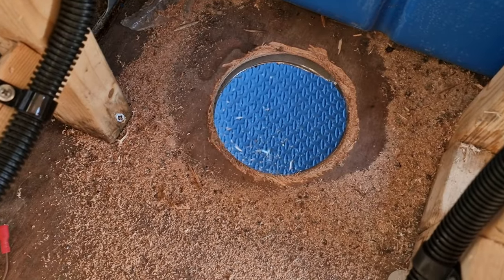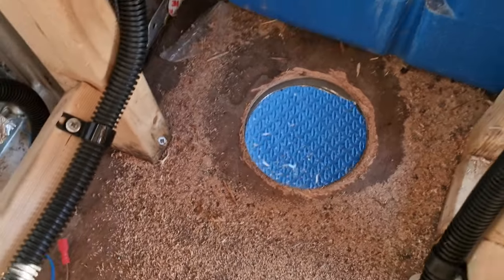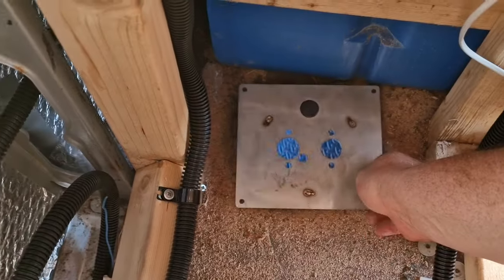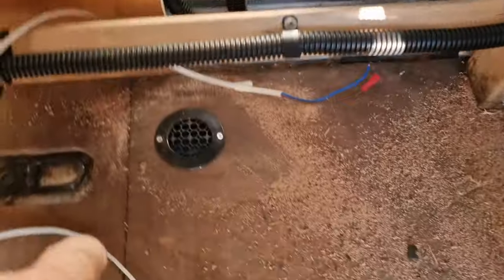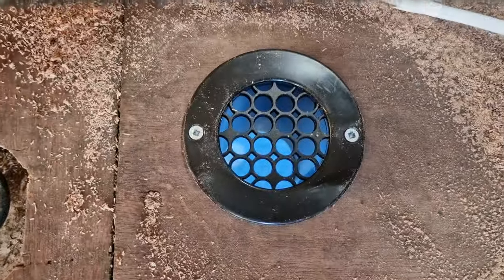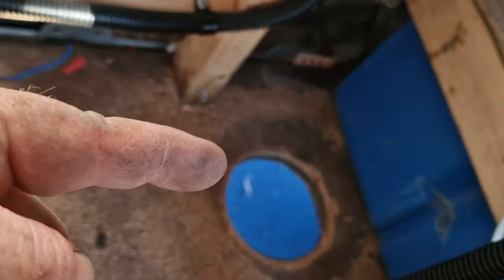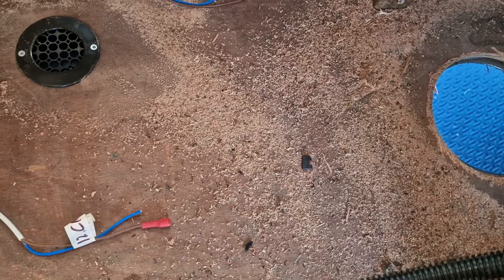So what we've got to do now is treat the metal and give it a little bit of a file up and drop that piece in, make sure it fits. The flange does need a little bit of filing to fit, but we'll do that now. And while I'm here, I've put a dropout vent in for the cooker in case that ever leaks. The exhaust is going to go way down that way away from where we are, so we should never get any back migration of fumes again.